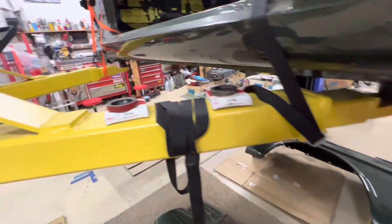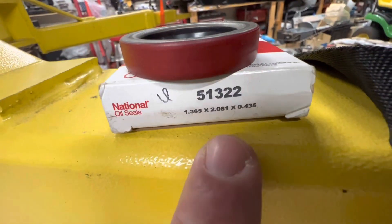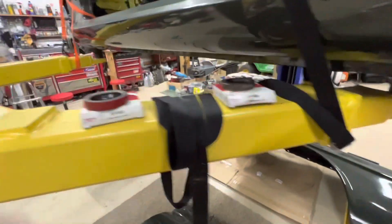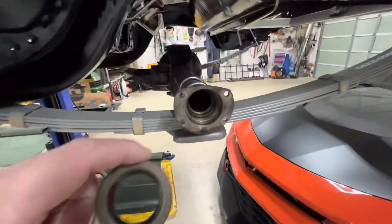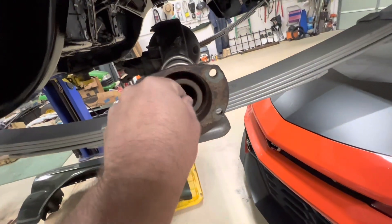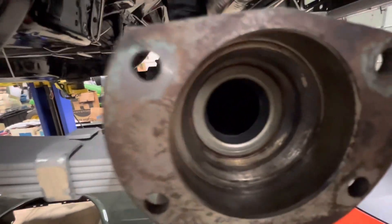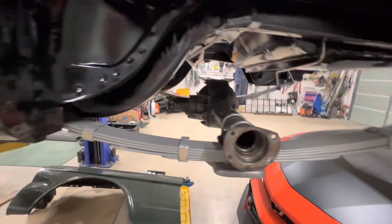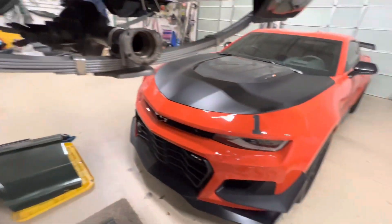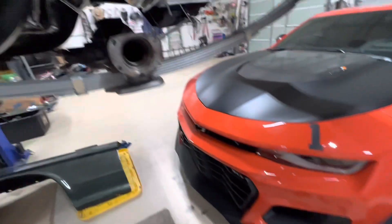This is the small flange, so you use a smaller axle gasket in there. I went and ordered these from a parts store, and it gives you the dimensions — that 2.081 right there is the outside diameter of this. Now the reason we're having this conversation, when it should have been something just simple, is that when I put this in here, you're supposed to be able to drive it in there. But as you can see, it just slips in there. The other side I was able to install, and I drove it in with this seal driver right here.